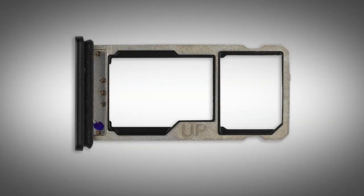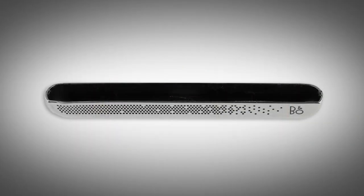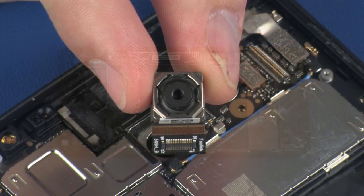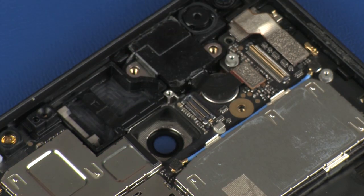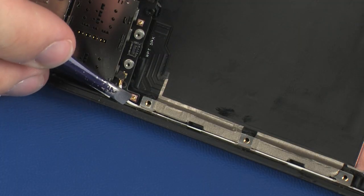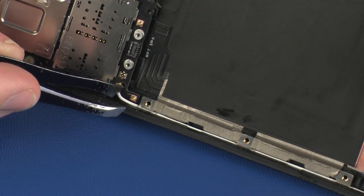Before you begin, remove the card reader tray, end cap, display panel assembly, chassis, and rear-facing webcam. Removal. Important: make careful note of the routing of all the cables for later replacement. Disconnect the wireless antenna cable from its connector on the system board.